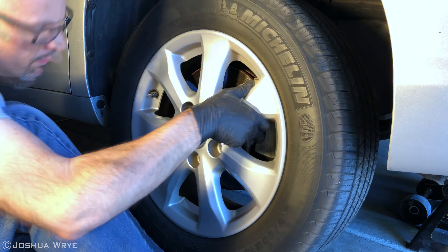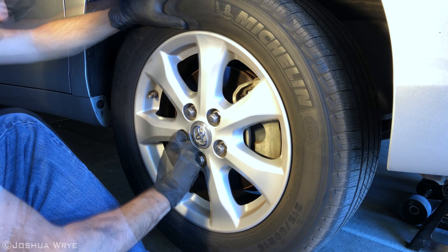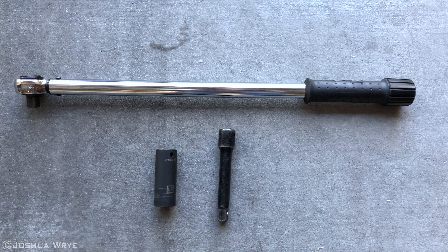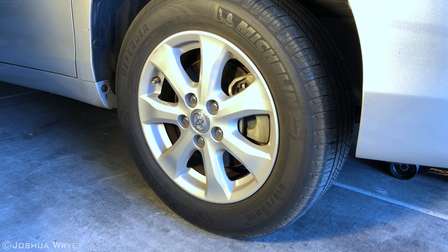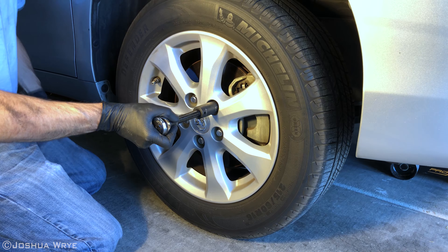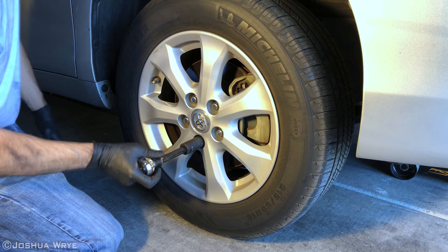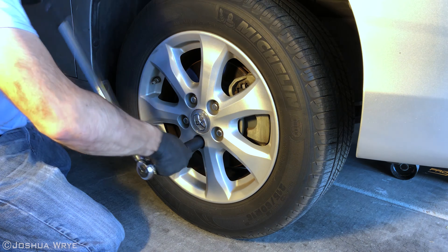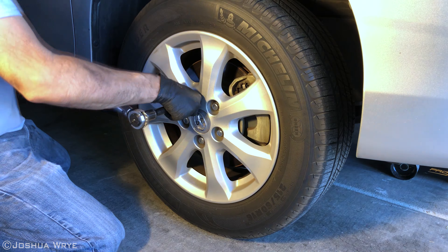You can place your foot underneath the tire to lift it up a little bit to get it onto the lugs. We'll use a torque wrench, a 4 inch extension, and a 21 millimeter socket to torque down the wheel. Using the jack, lower the car just a little bit to place the wheel on the ground. Using the torque wrench, torque the lug nuts down to 76 foot-pounds and go in a star pattern — this will make sure everything stays really tight. Once you are done, lower the vehicle the rest of the way and remove the jack. Now take your first spin.